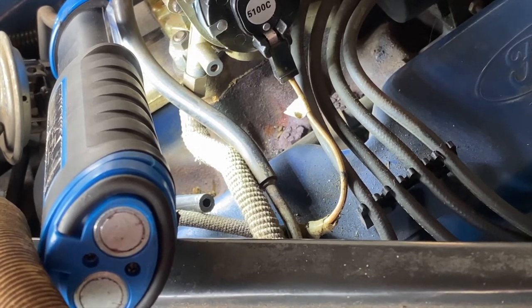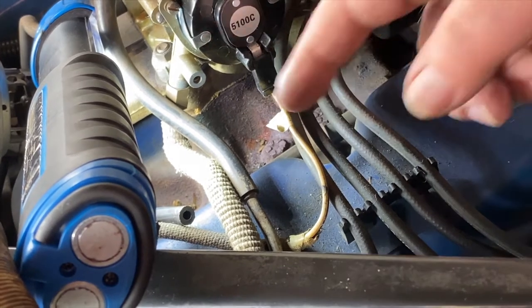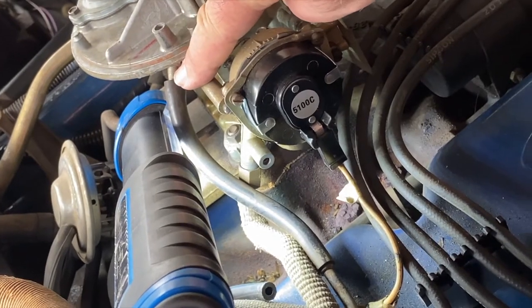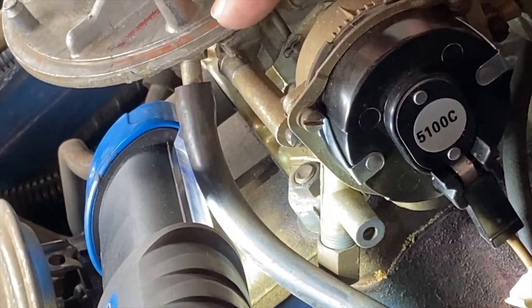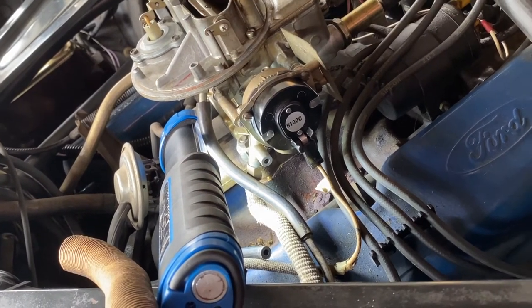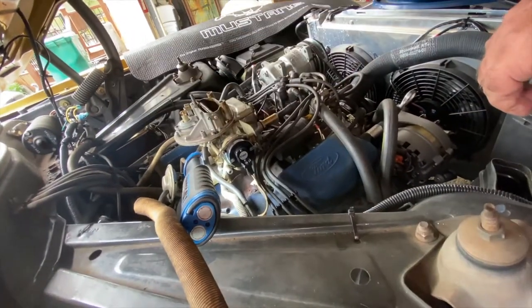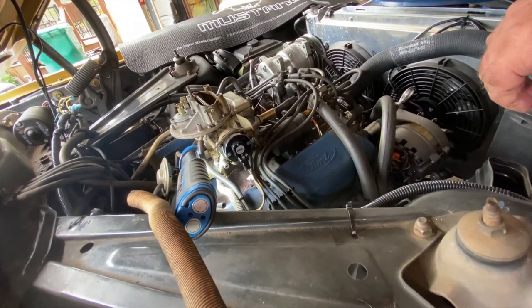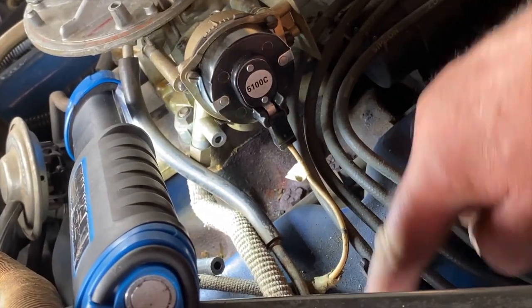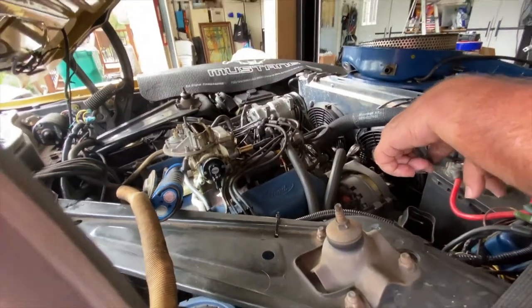The other side of the stove has a cold air inlet — that's what this is for. This rubber hose goes to the bottom of the upper air horn; right here there's an open hole inside of where the air filter is. There's clean air, and it brings cool air through this rubber hose to the metal hose down to that hot air stove. That's what that's all about.